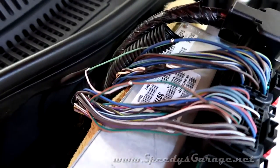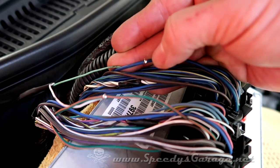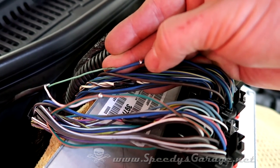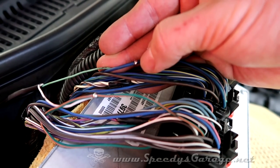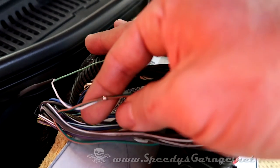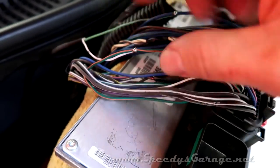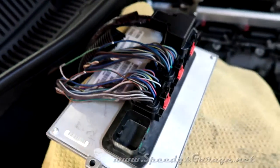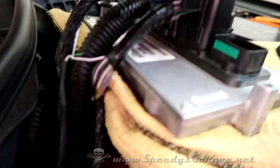When you get done, this is what you should end up with. Use proper soldering technique: touch the soldering iron to the wire, heat the wire up, and then touch the solder to the wire. You never touch the solder to the soldering iron — let the solder draw into the wire. That creates a good solder joint and you'll never have any problem with them. Now I'm going to tape everything back up, put our caps back on, and get back onto the interior. And there's what it looks like all tidied up and ready to go back in.